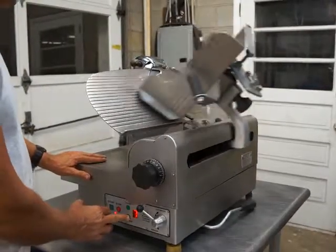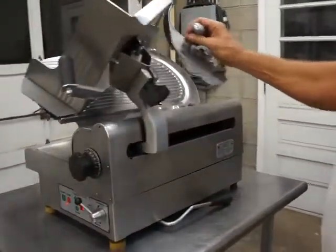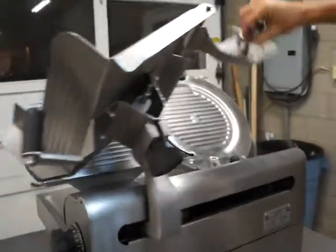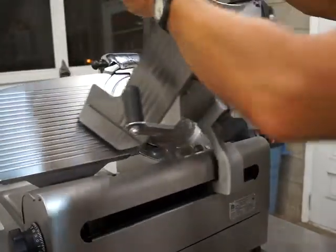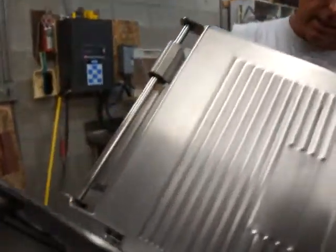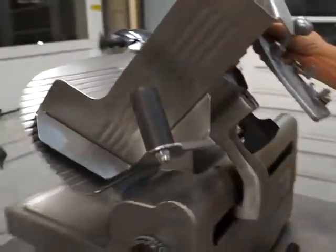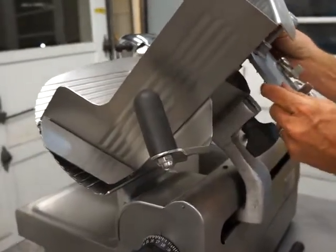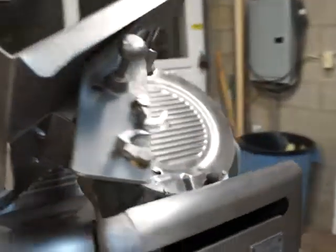Very smooth. Turn it back down. What you're moving is the arm at rest here — we've got the arm that you put down to the meat. On these Globe slicers that's nice because it's metal, and you can see the teeth on the other side are in very good condition. You'll see the teeth on this side in very good condition as well. We'll hang that back up on its hanger and shut it off. You can see the blade running there on manual.